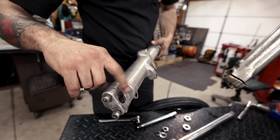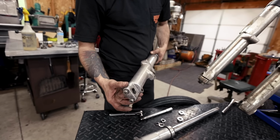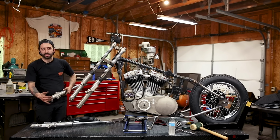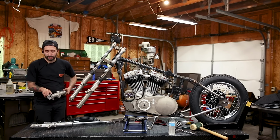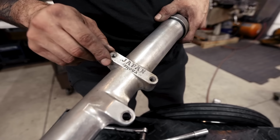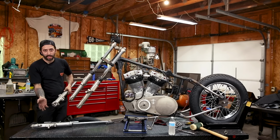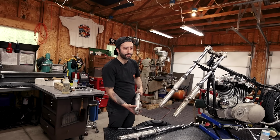I've also seen Showas that don't have this notch. I think it's for a single disc that actually gives you more clearance between the disc and your speedo drive, and it actually looks mirrored on both sides. And if you have that Showa front end, you should buy the single disc Kayaba, which I believe is also in the description on the Lowbrow website.